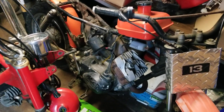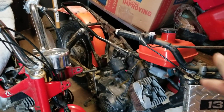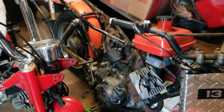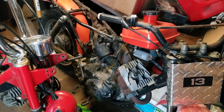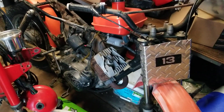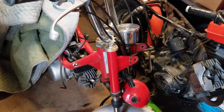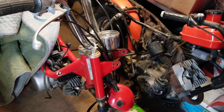And of course, here is the Harvey Spooner bike. We have the seat, oil tank, and side cover to do. We need to take off the fuel tank, cut that bracket off, mount the fuel tank properly, reconnect the oil line — you can see it's all plugged up and not done correctly. We need to find the rubber on the kickstarter — I've got a kickstarter and the proper bolt for it. We're going to change out the fuel system, clean up the carb, flush the system, and get the oil working. We also have the Chappie coming up.